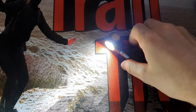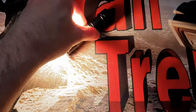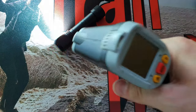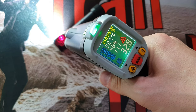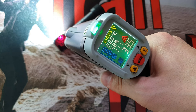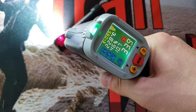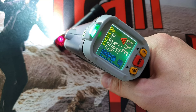So what I'm going to do is I'm going to get my heat monitor. Right, there it is. And what we'll do is we'll move that slightly, move it up to there. In fact, we'll put it like that so I can get a surface. There's a surface. So let's see what sort of a temperature we'll get here. Okay, so with an ambient temperature of about 22, 23 degrees, it's only hitting about 33, 34 degrees so far. We'll leave that on, see how far it goes.